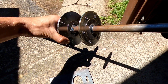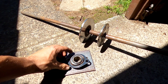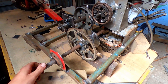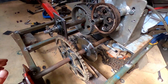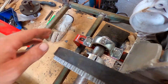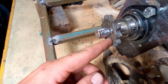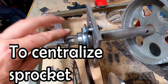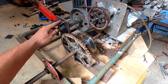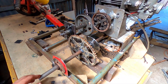I made a step on there so I can put the sprocket on, and cut this plate out to mount the other side of the belt drive pulley — it can slide back and forth. That axle is now mounted up with a sprocket on it. I've put the bearing on, slotted these holes so I can adjust it. I hammered a socket in through the pipe and tacked it, so I'll weld this off with a TIG. I need to make a brace that holds this bearing holder, mount the engine, and then foot pegs — that'll be pretty much it for the chassis.